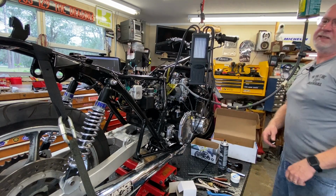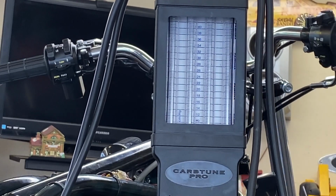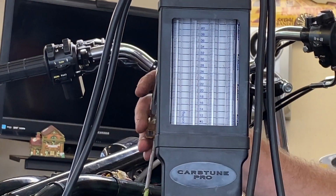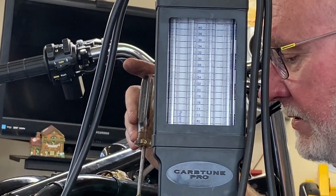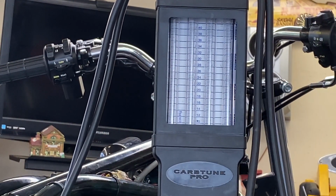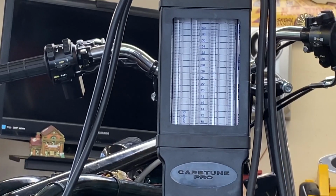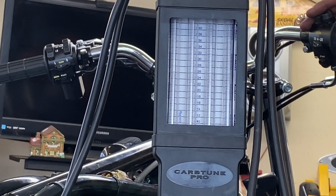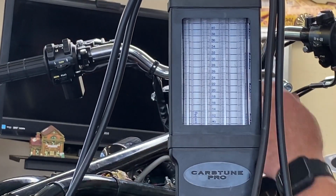Let's go ahead and pull the caps off of there and see what they look like. I'm going to put you on the carb tune. What I did was I cracked the adjusters. I'm going to show you all this detail later, but I looked into the intake side of number one, just taking the pod off, and those things look way open. Not a ton left on this adjustment though, but it's almost as if it's got a ginormous vacuum leak, but I just can't see that to be the case, because everything's on there the way it's supposed to be. So everything's tightened up, and it ran pretty good with the other carbs, so it can't be anything from here forward, the carbs forward. So all right, I'm going to have to glance around at this myself, so see what we can do together.